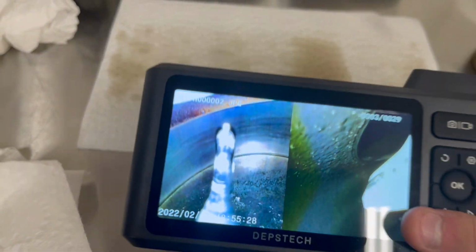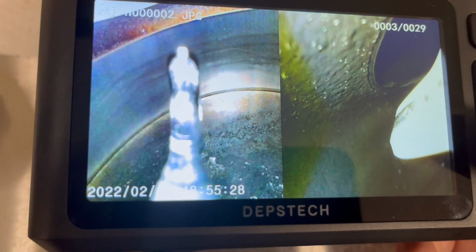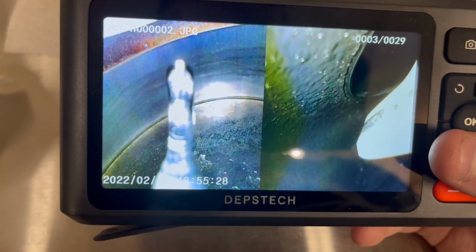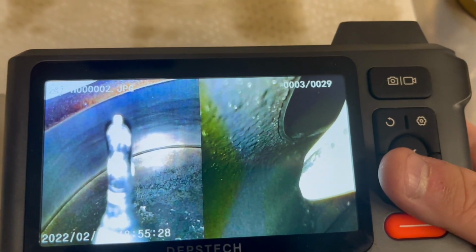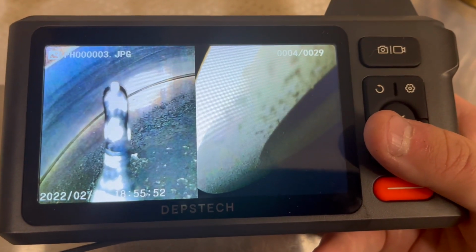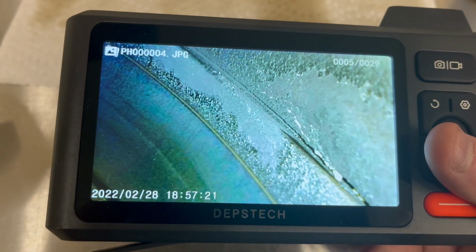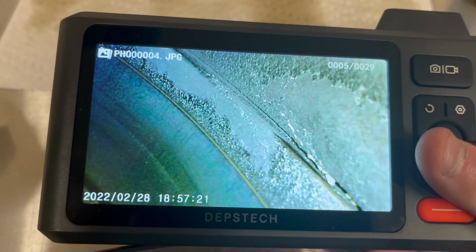But it's really interesting to see these pictures on the borescope. This is my number 6 cylinder, and you can see at the bottom there are some craters in the piston, but also you can see the aluminum on the top of the head next to the exhaust valve. That exhaust valve has a few little aluminum flakes, but what's interesting is I thought that was a crack in the head, but that's actually just a shadow.